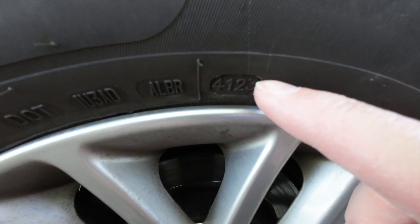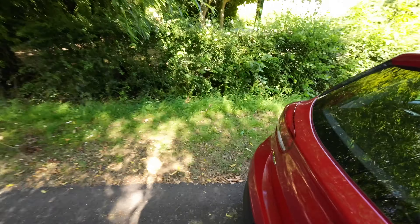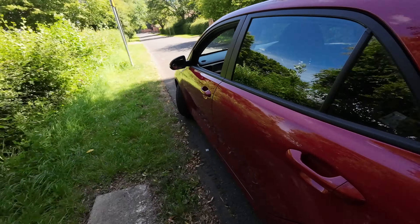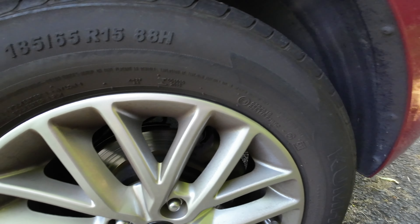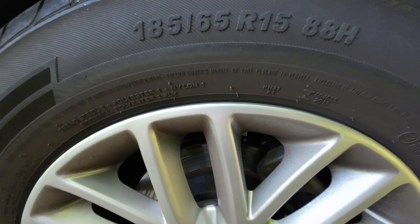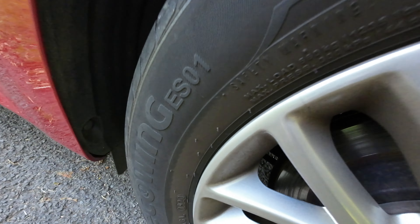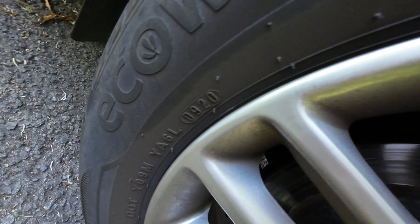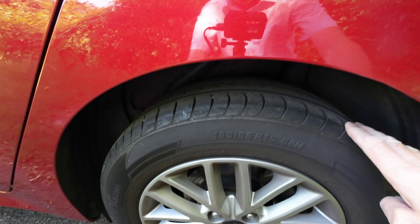So that's what you're looking for — a little rectangle box. Now if I go to the other side of the car — and this was with the car when I got it — let's find this one here. They're not always easy to find. Here we go, it's down here. You see it says 0920, so that one's four years old. Four years old is not particularly old.